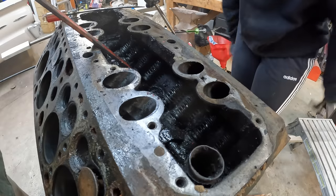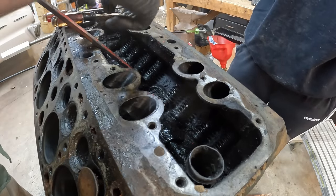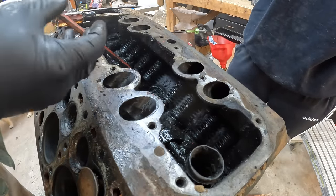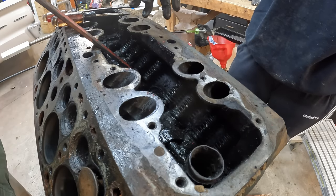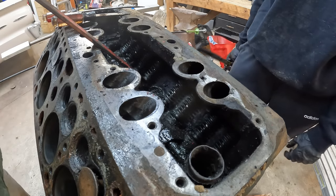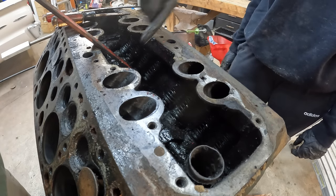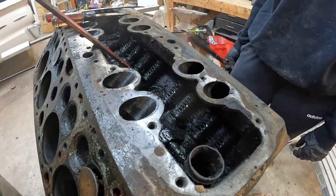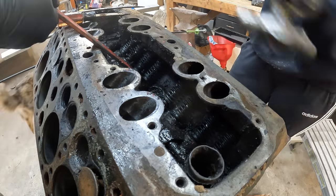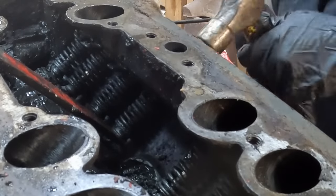All we've got to do is get a screwdriver behind it. I'll let off the spring, and that will release it from the rest of the retaining assembly. We can pull the valve straight out of the head, and then it's just a matter of pulling out the clips and the spring together, and then we're going to drive the valve guide backwards through the block and take it out here. Okay? Right. Make sense? Yeah. Let's try that. So the key is to just get right underneath it. So just tap harder.